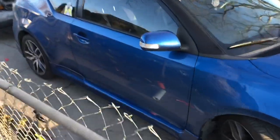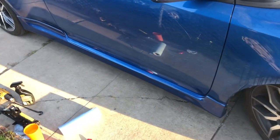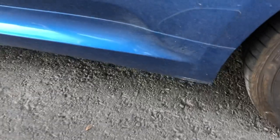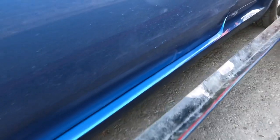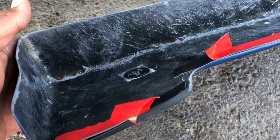I didn't really show the process of painting it because you can reference back to the valences video - it's the same procedure. Now I'm going to finish up this one. I'm going to go over the side skirt and just clean it with some soap and water or wax to make it look clean so the double-sided tape can adhere properly. Before applying the side skirt, we're going to remove the red tape backing a little bit, which will give us enough clearance to peel it off once it's already on the car.